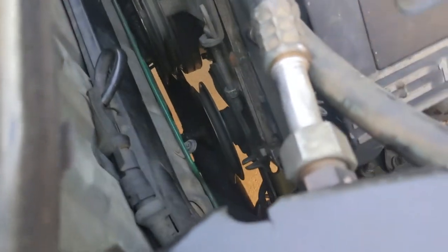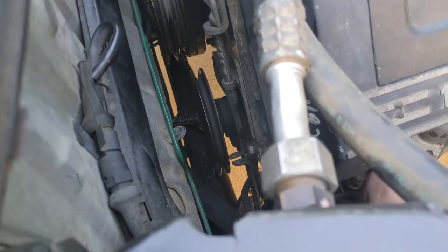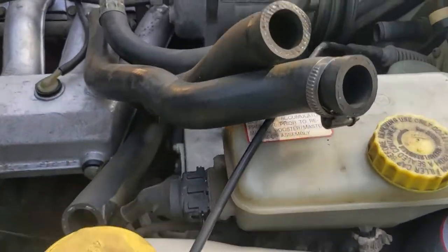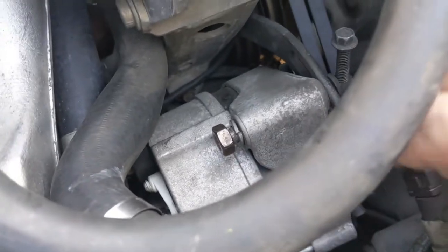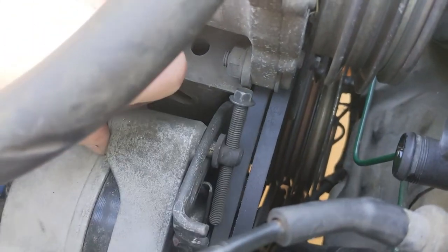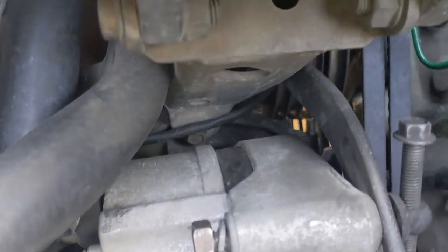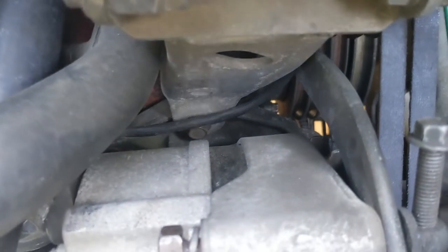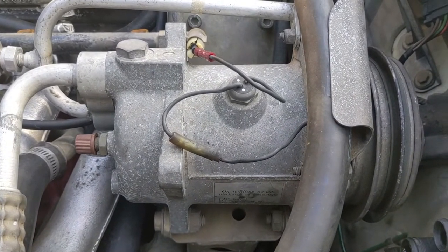The goal, just like the AC compressor which we're going to remove from the motor and leave in the car, is that I'm also going to unbolt the power steering pump and leave it in the car when I pull the engine. There is one more bolt — the bottom pivot bolt — but we'll get back to that in a second. Final step of this process: take the belt off the alternator and water pump. Really quite easy, especially once you've pulled the two heater hoses out of the way. All you need to do is remove this nut, which allows you to move the tensioner around. Once the tensioner is no longer engaged, rock the alternator up, pull the belts off, and the alternator swings out of the way.